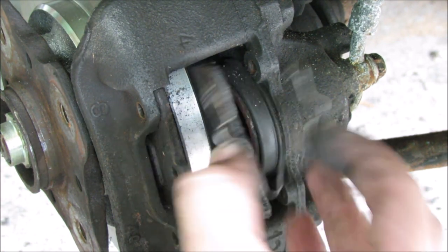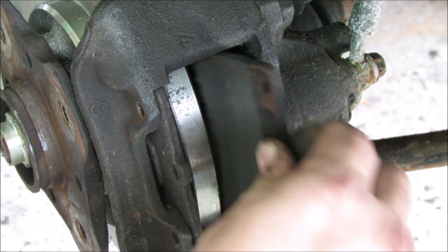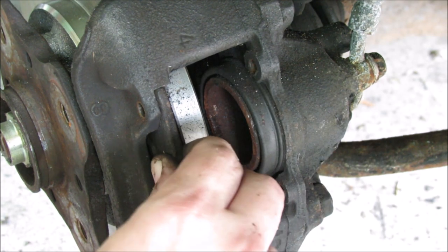With just a very little bit of pry, I got the hook to come out and it doesn't look like it's lost any of its springiness. We'll set that aside and go ahead and pull the pin out. We can remove this spring. We want to remember the order of all this stuff, and then our pads simply come right out.